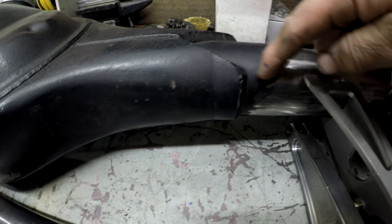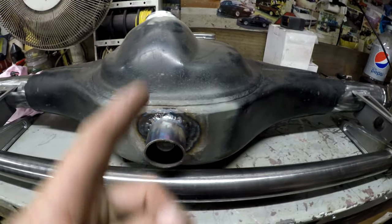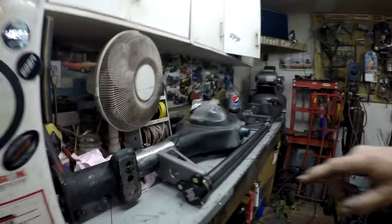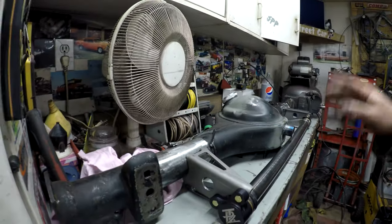You can tell there's a bigger gap here than there, but the housing is also kind of different lengths on each side. At first I thought I could use the center bolt but it's actually offset a little bit, so I had to do it this way. What I'm going to do now is just tack it for tonight — once it's tacked I'm hopefully going to be able to throw it in the car so that it's in there and I can start measuring. Then once I know this is good, I'll fully weld all these brackets and the housing will be done and ready to be repainted and put back together.